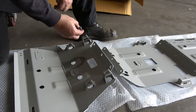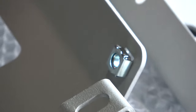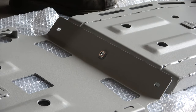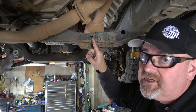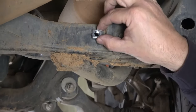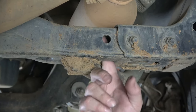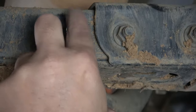We're going to start with the M8 cage nuts — the front panel takes three and the mid panel takes one, so we're installing those while everything's on the floor. We're also at the cross member for the transmission support, where instructions have us put the single 10 millimeter cage nut from behind into a small hole. We test it from the outside — it actually goes in there. It looks like it might spin when we tighten it, so we'll probably need pressure from behind with a finger.